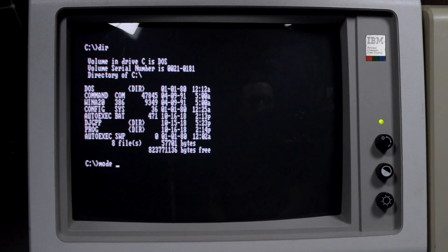The command to switch displays is named MODE. With MODE you can specify one of three options: mono, color 40, or color 80. Those are the same three settings you can choose in the BIOS of the 5150. Do keep in mind there is no option for EGA or VGA, as that would require knowledge the BIOS cannot have because it would have to load that off of the video card itself.